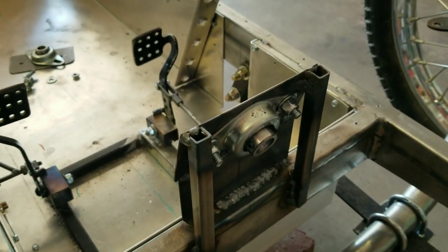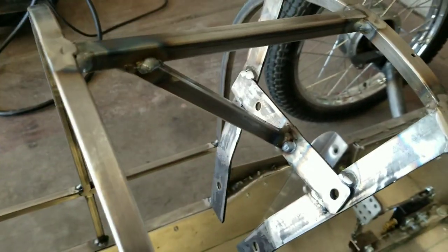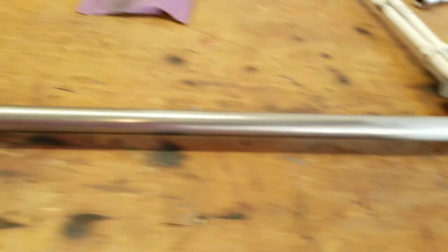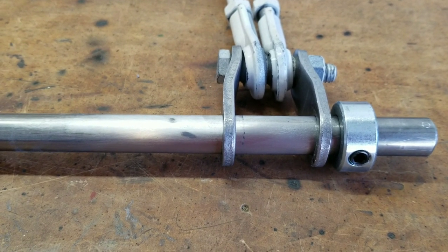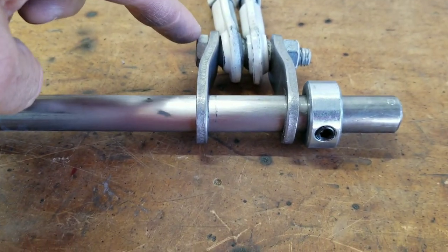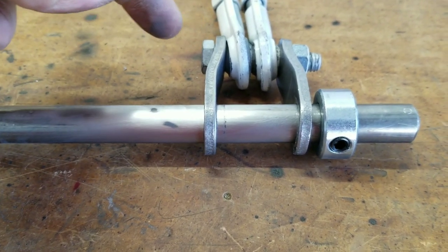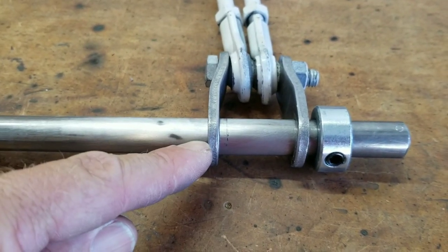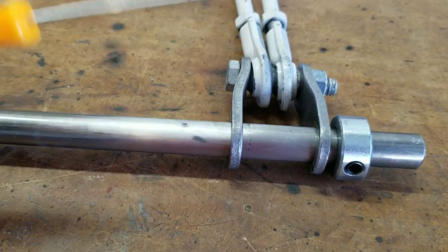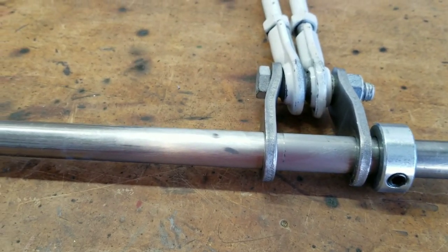I removed the steering shaft — I was able to leave that bearing in place just by unscrewing the two set screws. The bearing up here removes from the bracket. I added another support here just because it was wiggling a little bit. I've got this over on the bench and I've marked where the tie rods are going to be welded. The important thing here is to keep these level and parallel as best you can, and also make sure they don't interfere — this bolt, if you put it in the other direction, you'll probably never get it in and out again because the bracket's in the way. I've marked my tie rod with a scribe and cleaned the metal, so now I'm ready to put some welds around this shaft.